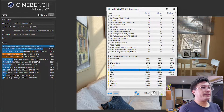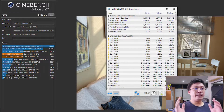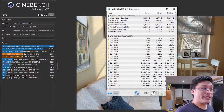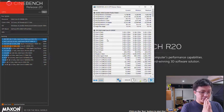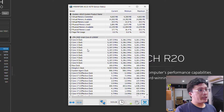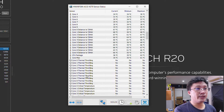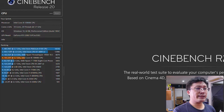That was a little bit disappointing — 6482. But now we have maintained 5.1 gigahertz on all 10 cores. Here comes the fun part: can I actually beat the AI? Let's find out. This is where I'm trying to beat the AI. I've set it to x52 manually, so we are now at 5.2 gigahertz. I've also taken the liberty of adjusting the vcore voltage and a couple of other settings. I have a constant 5.2 gigahertz. Let's see what kind of scores we're going to get.